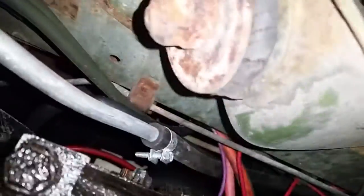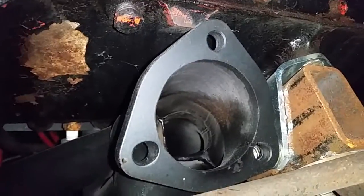It's got like a reverse Mustang suspension. With the frame rails right there it's really tight — the frame rail right here too, it's really tight. So you can't do shorty headers, it just won't fit. A log manifold doesn't flow enough, and with the proper placement the block hugger headers are about the only thing that will fit.